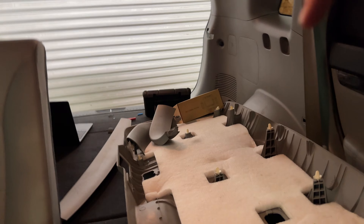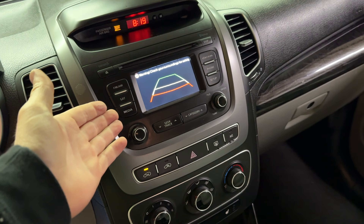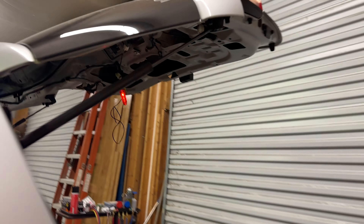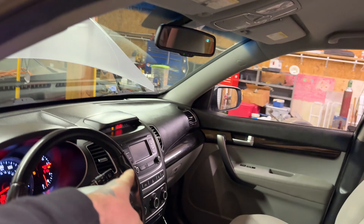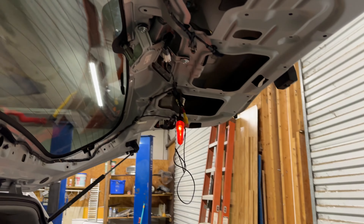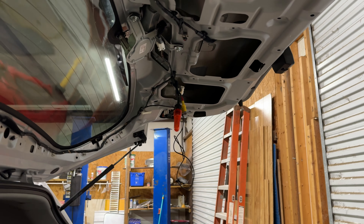I've got a diagram pulled up of that camera system — it's only four wires to worry about: a power, ground, and two signal wires. Somebody already took all the back paneling off. I've got it in reverse and of course no picture, but back here I found my power and ground wires going to this camera. I put it back into park and the screen goes back to radio. It's on some kind of timed power circuit, but we've got good power and good ground.